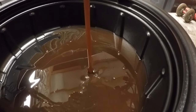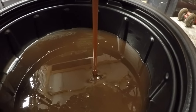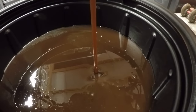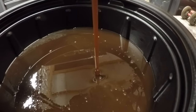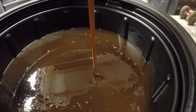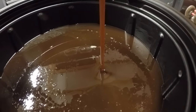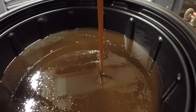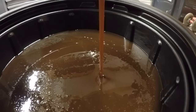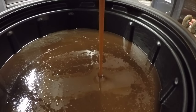It stinks. It's very chocolatey. There's a little bit of emulsification of the oil, so there's a little bit of water built up. Actually, it looks to have been a good quality oil that's just been sat in there too long, rather than a lack of oil changes. It's just cloudy, not dirty. And it's full actually, so okay, positive sign.